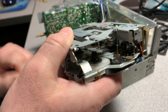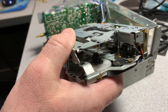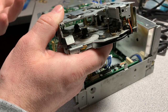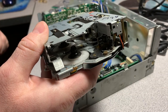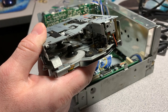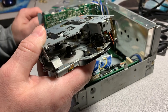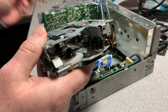The problem is if they're not precision manufactured - and in today's day and age that's hard to find - they will have a slight channel imbalance. There's also a more modern version: a Bluetooth module mounted inside a cassette shell. It does the same thing but requires no wires, using a little battery pack. The downfall is you've got to charge it, and the battery might not last long or could potentially puff up and damage your cassette deck.